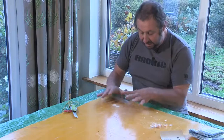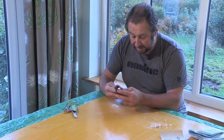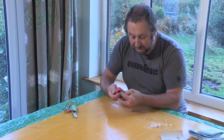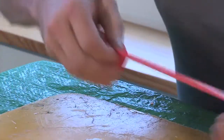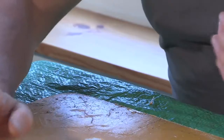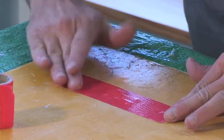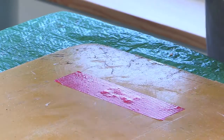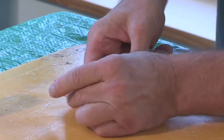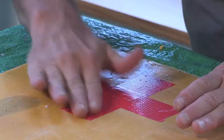We now need to make that area basically resin-proof. We're going to use some gaffer tape from our kit and just put a patch on the outside to stop the resin running through while we repair the inside. A few patches just to seal the holes. That now gives us something to work from. So this is the outer skin of our kayak - we're now going to go to the inside.